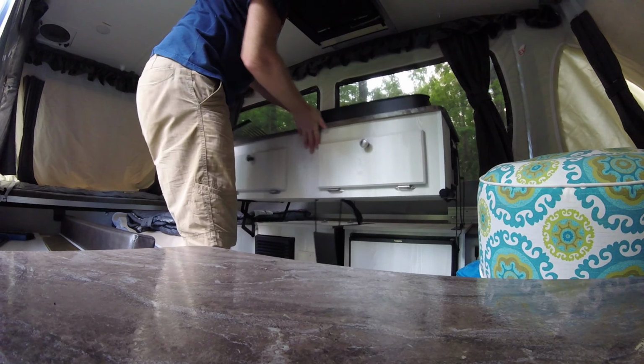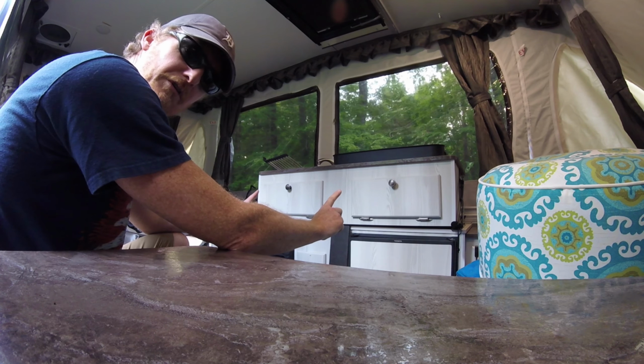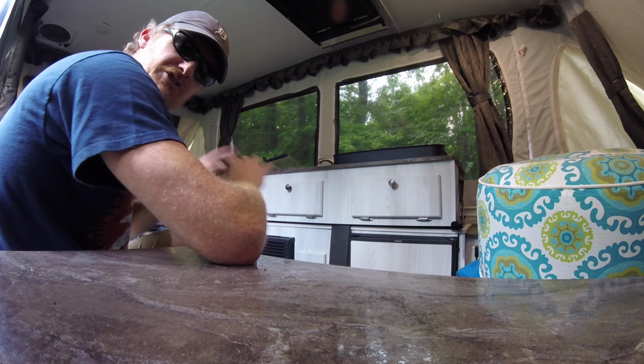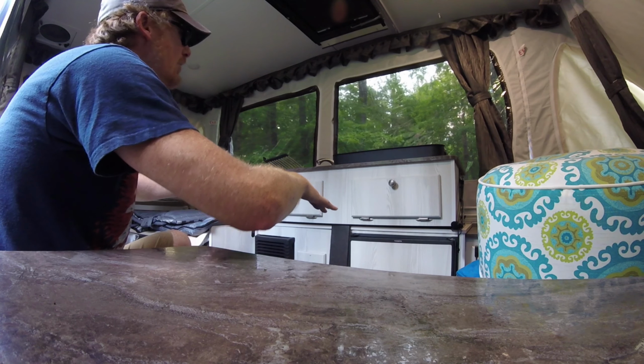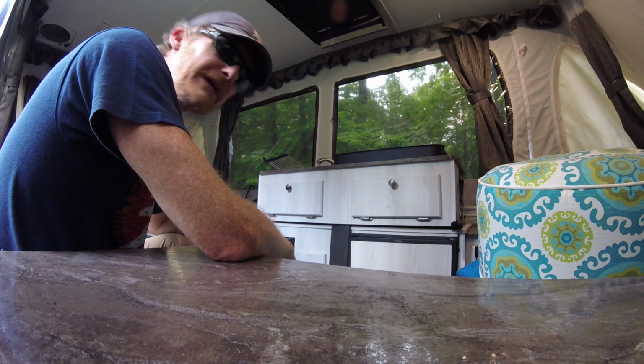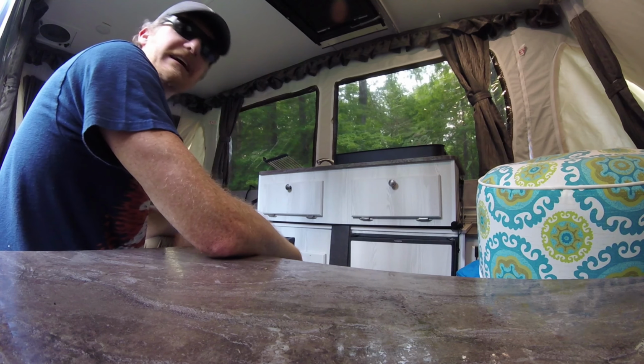So when you lift that sink device, the sink and the oven, up, and you set it down, there are two safety switches underneath. One is electric, one is gas. When you lift and put this down, it shuts off the electric, it shuts off the gas. When you put it back up, it turns them on. Even though I was plugged in, no electricity was flowing, it is now, and I can turn on the lights.